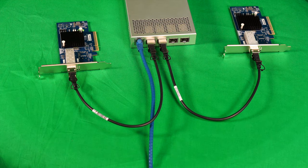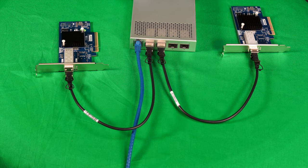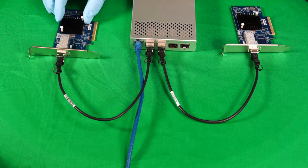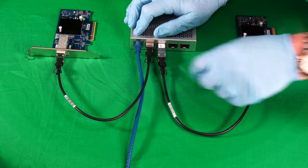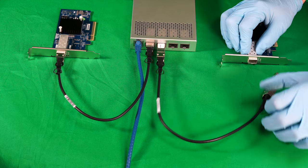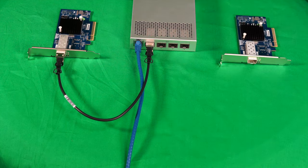This port is only a single gigabit, so it doesn't matter what you plug it into — it's one gig. Now let's assume the more realistic case where one of these PCs is further away and needs to be connected through some other means, like fiber. So let's get rid of the direct-attach copper on this one side and replace it with a fiber link.